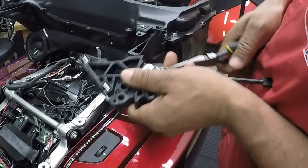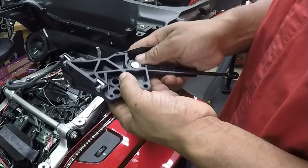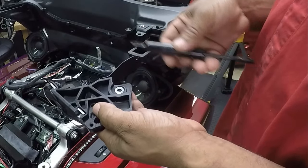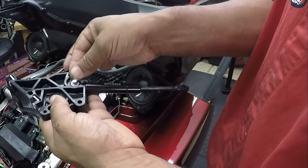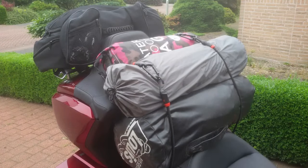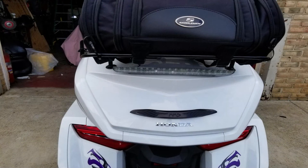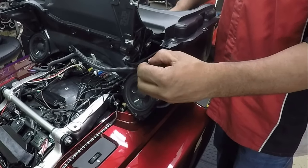That damper is for carrying a heavier load on top of your trunk rack to sturdy up the hinges. So if you're not going to be carrying a heavy load on your trunk rack, in my personal opinion it is not necessary to change out the dampers. In my installation I went through with the damper changing process, but if you're not carrying a heavily loaded bag on top of your trunk rack, changing out the dampers is not necessary. The dampers are only used to assist lifting the trunk lid when carrying a heavy bag.